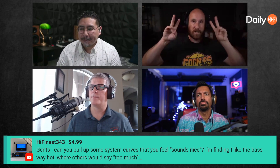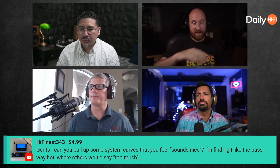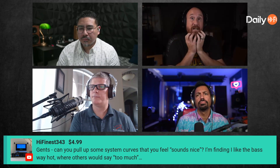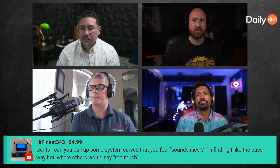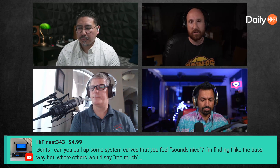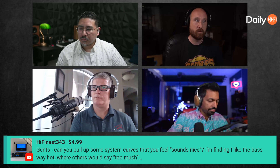Where's your starting point and end point for that curve? If you start at 20 Hz and your end point is 20 kHz, is it smooth all the way down or do you like a little drop in the midrange and then flatten out? I've seen all sorts of different responses from home audio and car audio. A lot of the time people are iterating over and over trying to get a response that sounds right, but in my experience a lot of times it's actually issues — like resonances or something rattling — that they're trying to resolve through the curve.